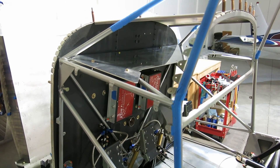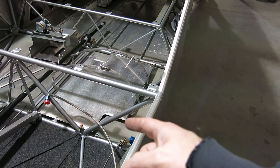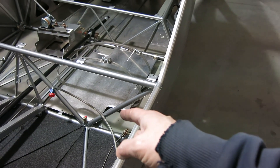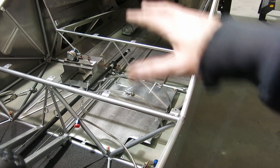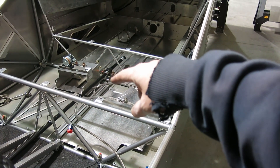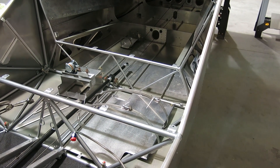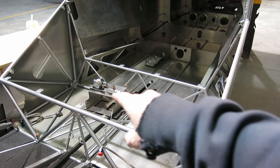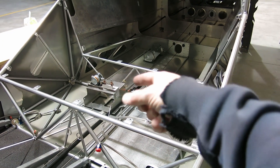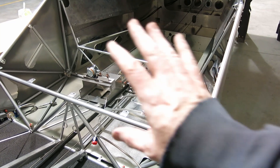We were going to work on the header tank. We've got that header tank done minus the sump — we haven't done that yet, and we haven't put all the fittings in. We did the low fuel switch and we've been letting it sit. We did some pro seal on that and been letting it sit for a month. I've got the battery box laying there — I still need to get the fuse holders installed there. I've been calling it circuit breaker and got corrected on that, so I need to get the fuse holders installed, and then we can put that battery box back in.